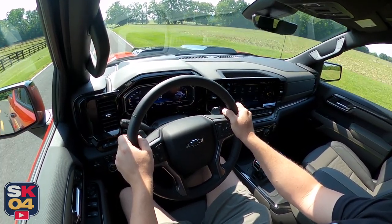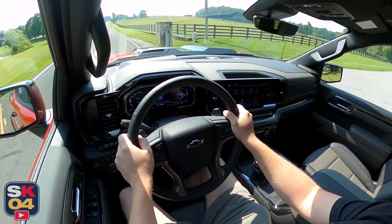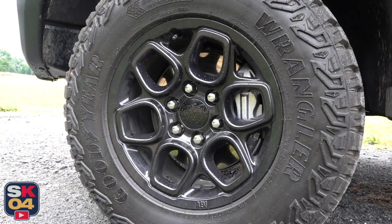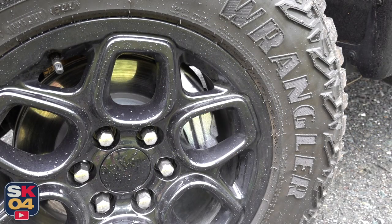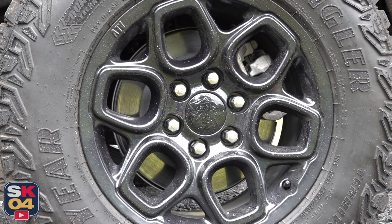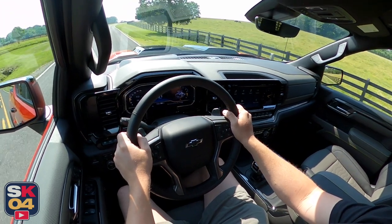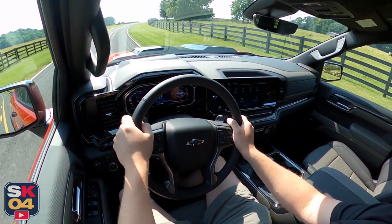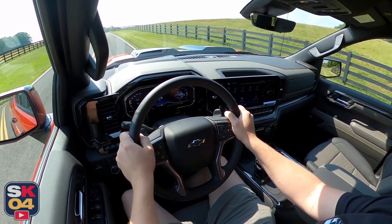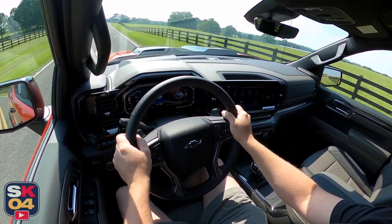As far as the brakes, all Silverados feature four-wheel internally ventilated DuraLife rotors with electrohydraulic power assistance and ABS. The rotors span 13 by 1.18 inches in front and 13.6 by 0.79 inches in the rear. They're clamped down by four-piston and single-piston calipers, respectively. Stopping from 60 miles an hour, unloaded takes about 126 feet. The DuraLife brake rotors have better resistance to corrosion to increase rotor life, minimize brake pulsation, and improve aesthetic appearance. The rotors feature a corrosion-fighting process called ferritic nitrocarburizing, which can double rotor life expectancy and reduce or minimize rust.